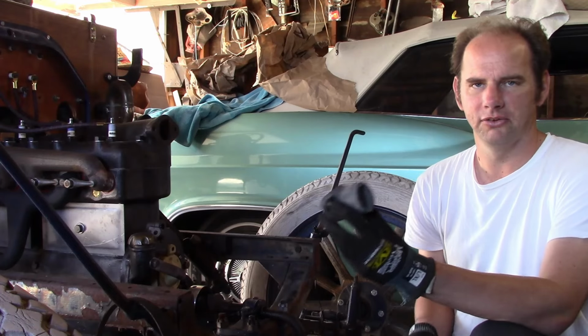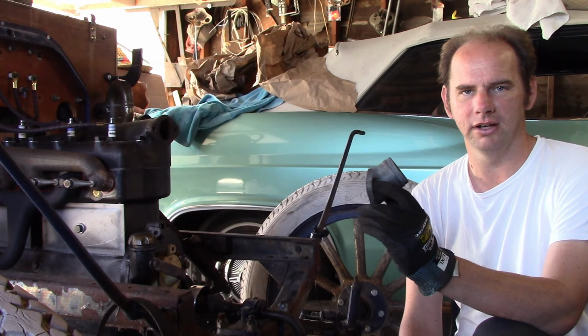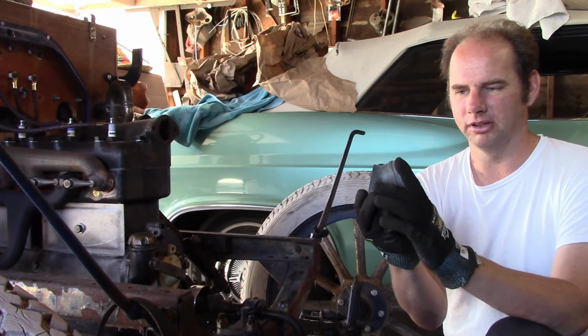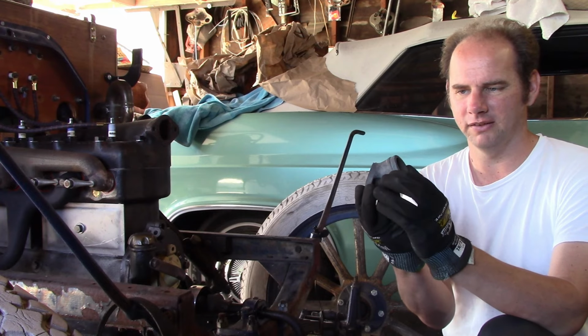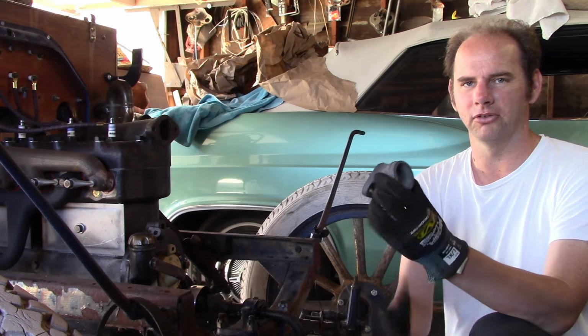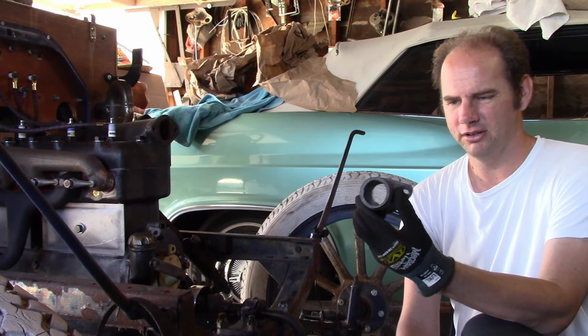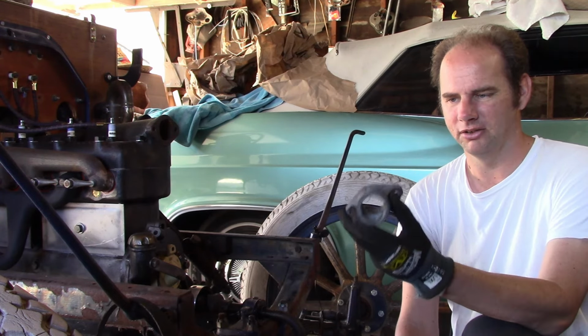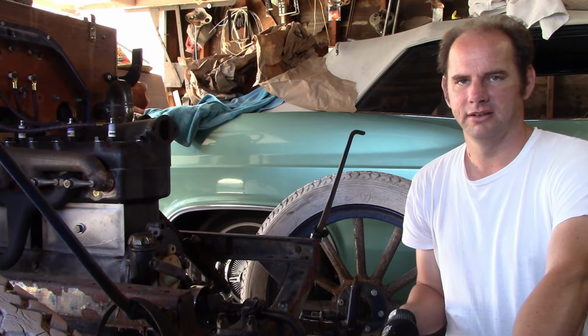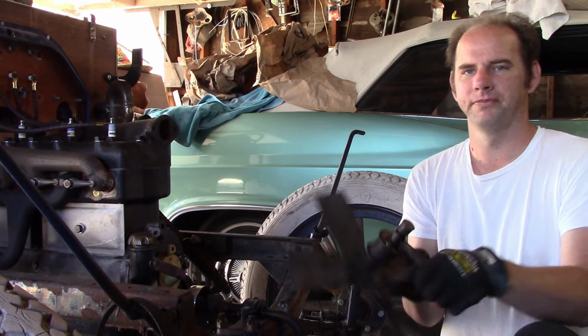The first thing is the water outlet that goes on the cylinder head. The brass era radiator uses all its own. It's really stubby, and it just points slightly up, as opposed to the 1917 and newer ones, which point almost straight up. You don't see good originals around very often, but it doesn't really matter because you can buy them new fairly easily. The other thing is the cooling fan.